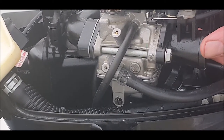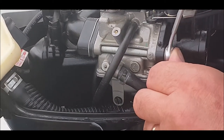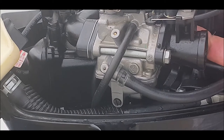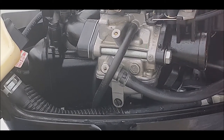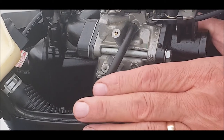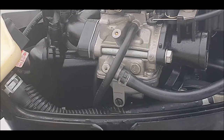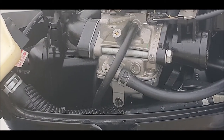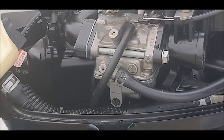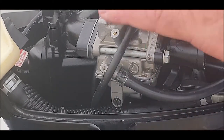You can just get a quarter of a turn on it, so just up him. I don't know how you're getting in. Okay. Quarter of a turn. That's it. That's enough. So before you put it all back together, make sure everything works, you know, you can choke. Hopefully we've solved the problem. We put the jet back in, we've cleaned it all. Looks tidy.